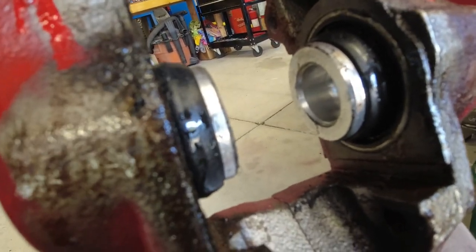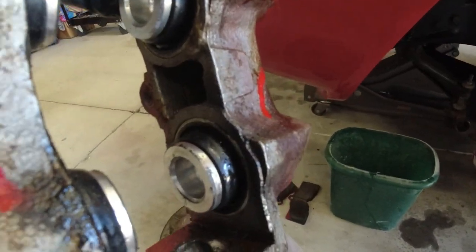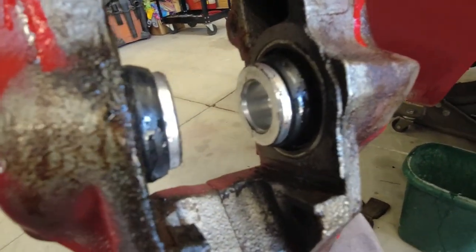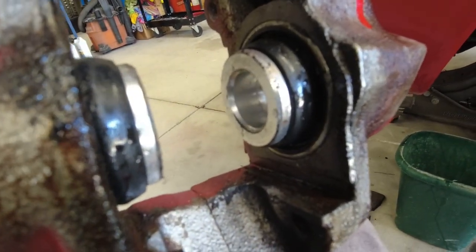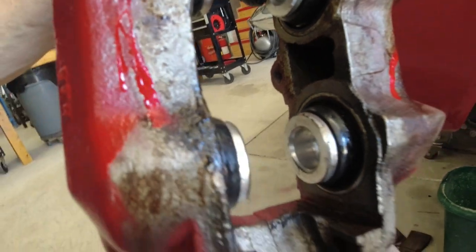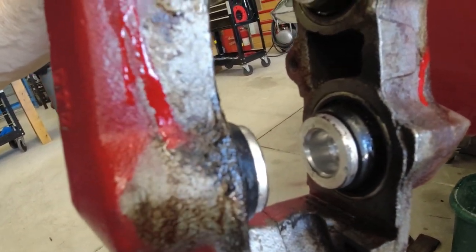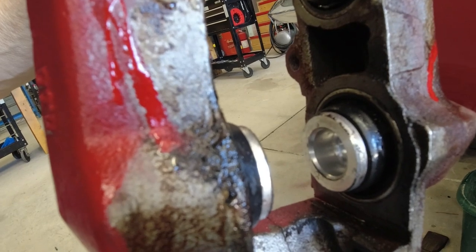They're cast iron bore — this looks like it's got aluminum pistons in it. The bad thing with these stock pistons is they have a lip seal in them, and those lip seals tend to leak over time, especially when they sit for long periods of time. I think this car must have sat for a long time after they finished it.